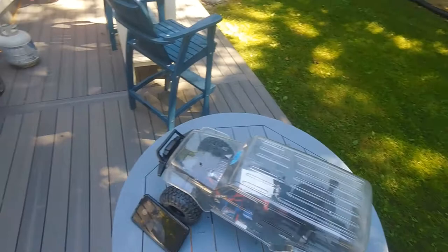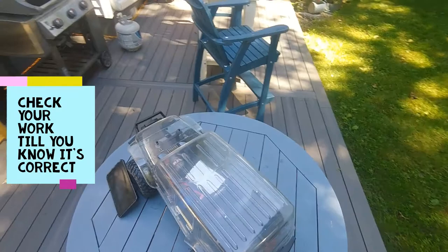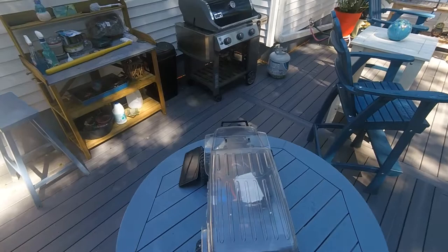That's where you got to be careful. Make sure your posts — when you drill your front ones out — put it in, lift it up so everything's even, and these lay on top; this is just laying underneath. Check your body, make sure it's lined up left to right. Because if it's over here a little bit and you drill those holes, you're screwed. You're going to have a crooked body forever and have to put more holes in it. So make sure the center of this is the center of the bumper.